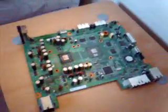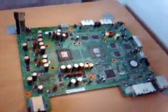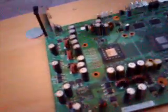This is basically the same as the heat gun, except it's at a lower temperature, and there's less chance of damaging all these. So for example, with the heat gun, as you're heating all of your Xbox, all them little silver bits there, they're hot solders, and if one of them melted and fell off, you'd be screwed. And try to focus it mainly on the part that you think's broken, or on the CPU, but do it in circular motions so that it doesn't break all the others. And that's it basically, really.